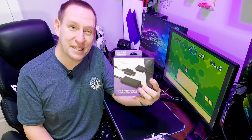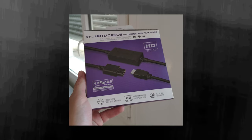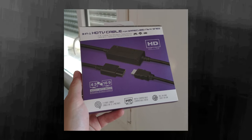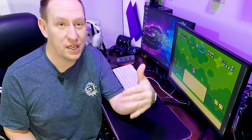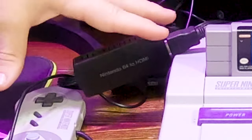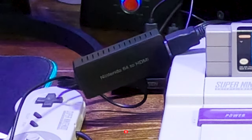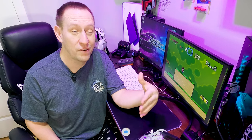The thing that makes this one potentially better is that this cable claims to use the S-video signal to bump up to HDMI. That's because the Super Nintendo actually really only outputs the S-video signal. So even though this one claims to be using the component signal, I don't think the Super Nintendo is actually putting a component signal out for it to use. Picture quality is pretty good, but I'm hoping it'll be a little bit better.